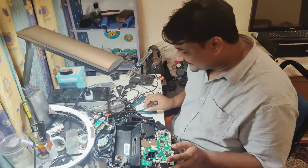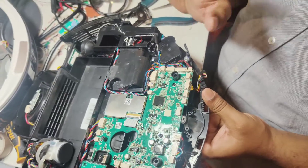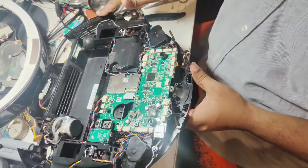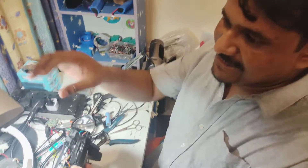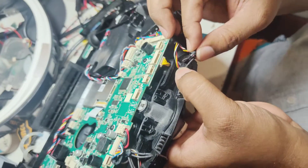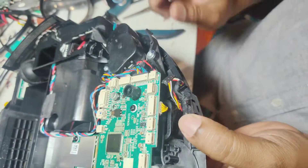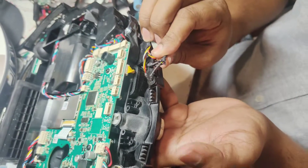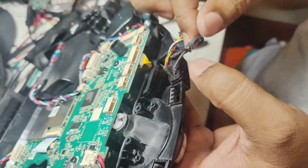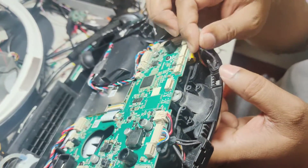So I decided to open this wire to investigate. This is a tip for all customers: if you've already checked or replaced the left and right sensors and it's still giving an error, let me show you what the reason could be. Be careful — the front sensor wire is very fragile. When I took out this wire, you can see it was already like that. I showed my son: 'This wire is very fragile, it just comes out from here.' It had disconnected from here. I just need to peel it off and solder it back — I already have the soldering iron on.